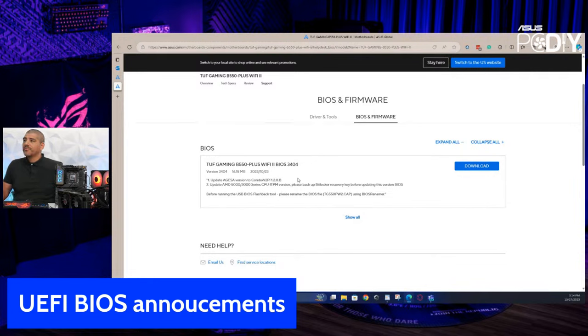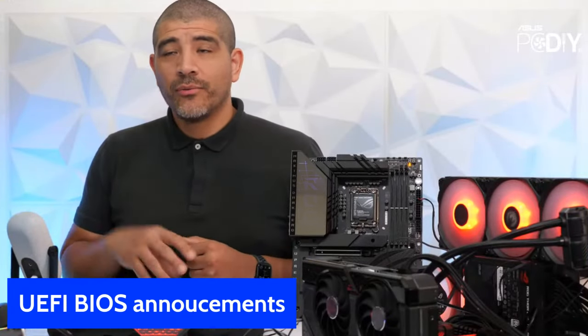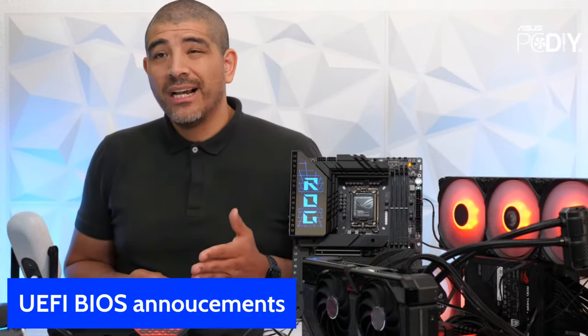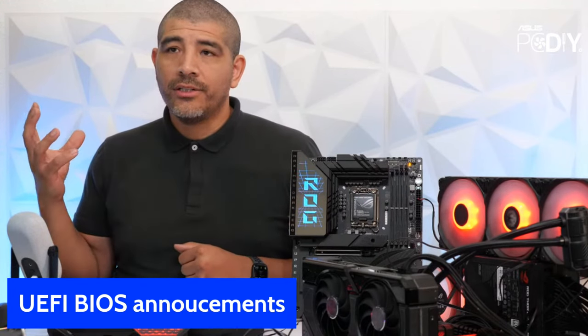Okay? So again, no need to worry if your system's already running without any issues. But if you are maybe putting together a new system, maybe you haven't updated in quite some time, maybe you're looking to maximize interoperability and compatibility, or maybe you were previously experiencing those USB-based issues, you can consider updating. As always, though, keep in mind that if you're overclocking, you would want to retune your overclock specific to the new UEFI. I also recommend installing updated chipset drivers after you update any core UEFI BIOS update.